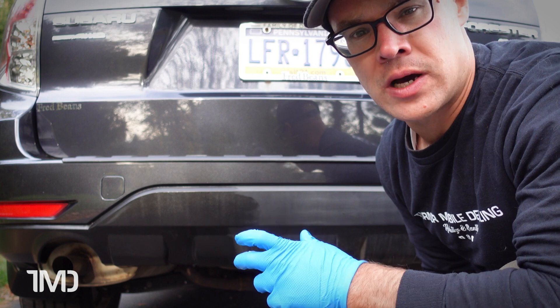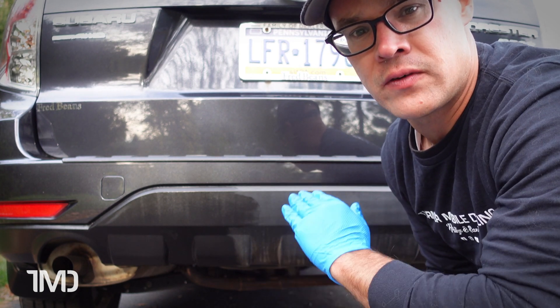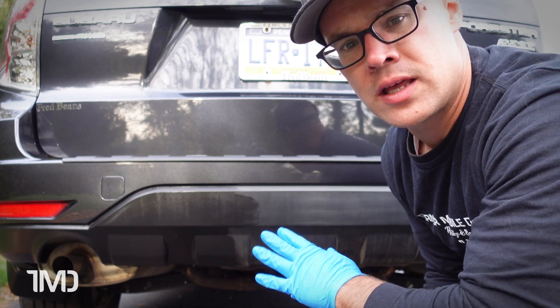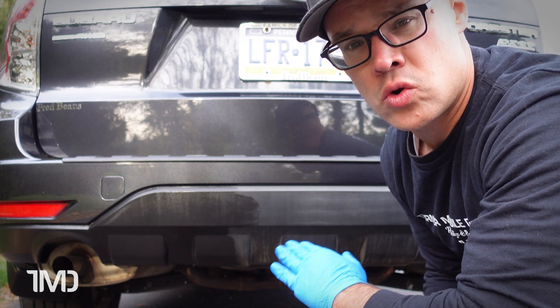What I'm going to do is leave about a three to six inch section right here in the center of the bumper free of any treatment — just bare plastic. That way we can maintain a control section between the two dressings, and that'll give us a much better idea as to the fading process and when it's totally gone.